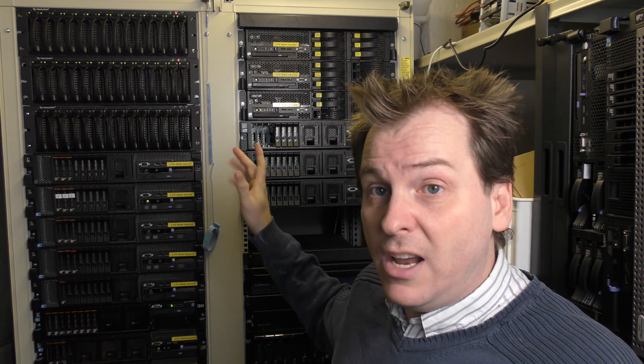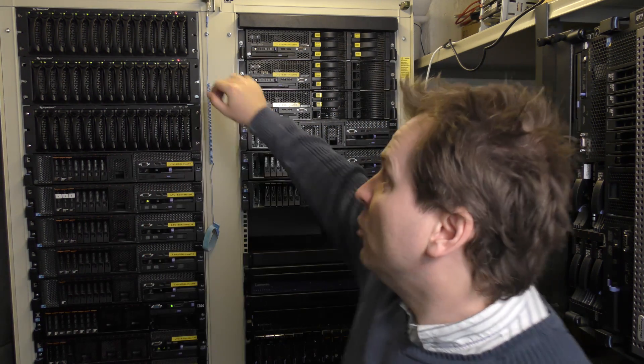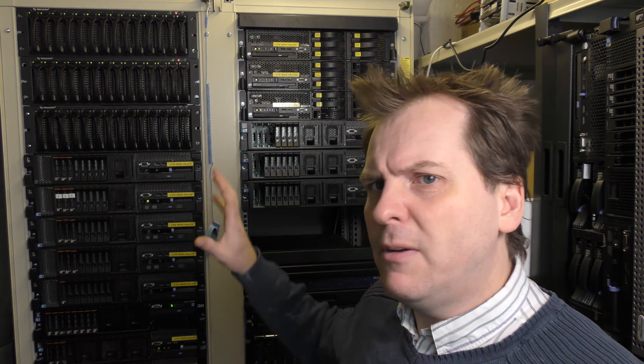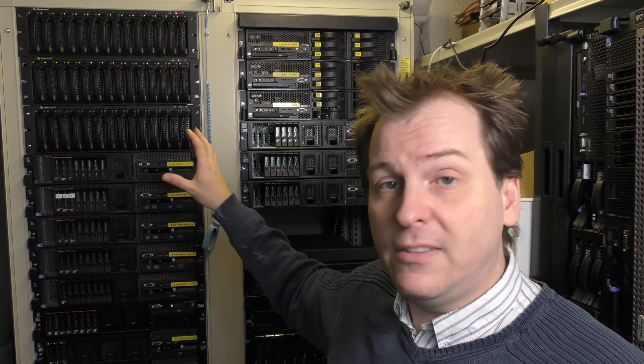I thought I should empty these out and try to find the issue or replace drives, but if I just started right now trying to find errors and swap drives there's a very big chance I would mess something up and lose all my data. I do have another backup up here, but an idiot might start taking drives from there and put them in here and destroy both arrays. It's much safer to use the slow time, move everything away, have a good copy, and then I can mess up all I want - it doesn't matter, it'll just be another copy.